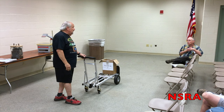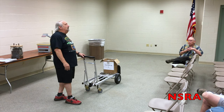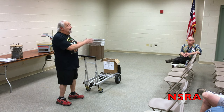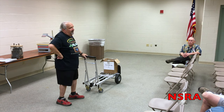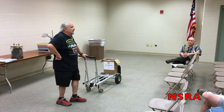So, are the gel batteries susceptible to the same thing? Oh, yeah. Sulfation in the bottom? Yep, it's exactly the same. Now, sulfation going to the bottom, no, not as readily, because it can't get through the absorbed glass mat. But the absorbed glass mat is a porous thing. So, yeah, stuff comes through, but sulfation or the shorting of plates happens more readily in a wet battery than it does in a gel battery.